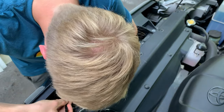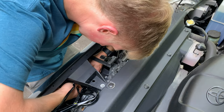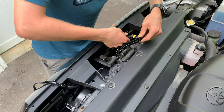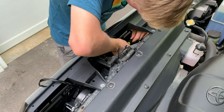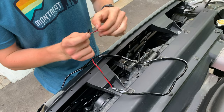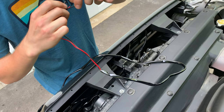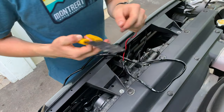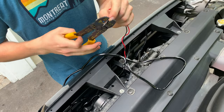Now for the electrical work. Take the wiring harness that came with the lights — there are four quick connectors that you snap in along the line, making sure they all run underneath the two big support brackets on the grille so you can still shut the hood. Those quick connectors have little rubber gaskets so no water gets into the electrical components. At the other end of the wire, strip both the red and black ends, and match the black O-ring connector to the black wire, making sure it's snug and won't fall off from vibrations.